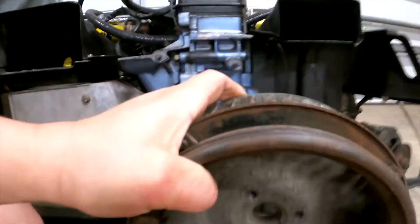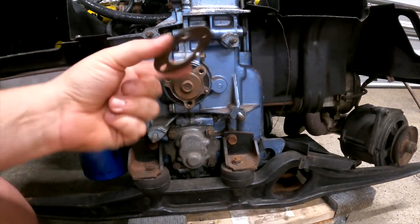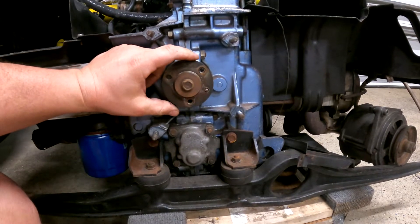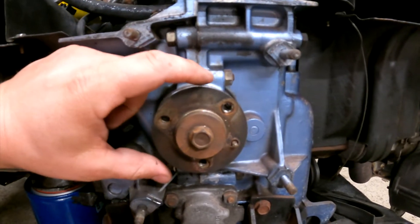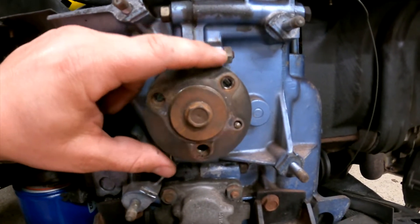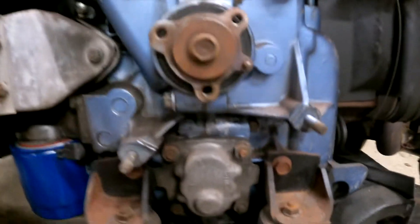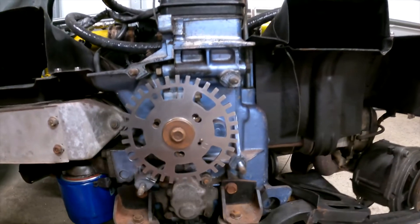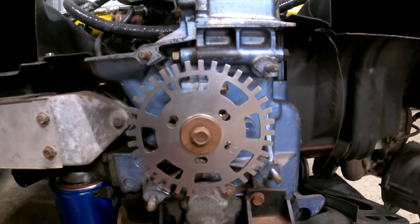So we hand this off here — it has a nice snug fit — and then there is a washer. This is where the pulley for air conditioning would go if you had that on your car. If you have air conditioning, you'll need to talk to the Dub Shop about how to get this to fit. I don't have AC, and if I do I'll go with electric air conditioning. So this washer comes off, our crank trigger will sit right here, and then the fan will sandwich it back in place. Let's take a look at the Dub Shop kit.